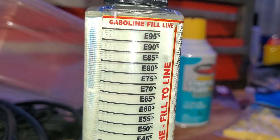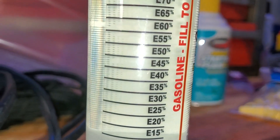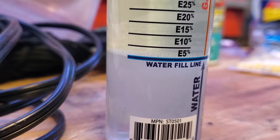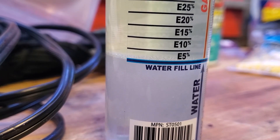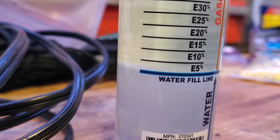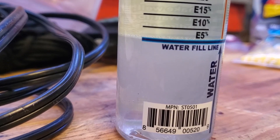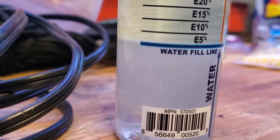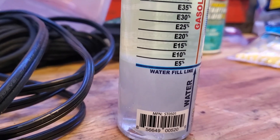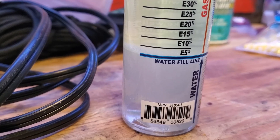Here is the result — you can see the fuel level is still up to the red line, and then coming down here — let me get the camera to focus — you can see the line. This particular fuel has little to no ethanol in it, which is exactly what you want for summer storage when using completely non-ethanol fuel. You can pick up this little tester; it's kind of fun to play with if you're curious about the fuel in your town — about $12 and I'll link to it in the description.